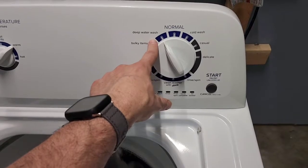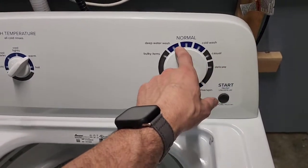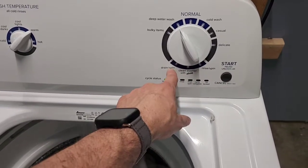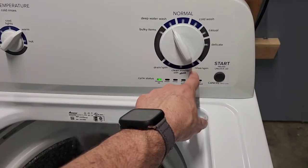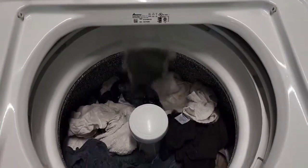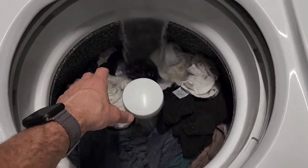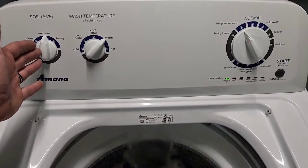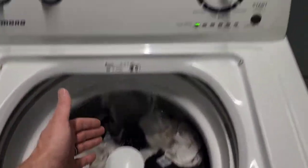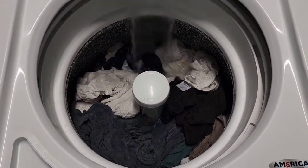It's filling up with water. I have it set on the deep water wash — that's the cycle I prefer. You've also got cycles for delicates, a normal range to save water, a clean washer cycle with a fresh tablet, drain and spin, and rinse and spin. Soil level tells the machine how long to agitate the clothes — it doesn't designate water level like machines used to. It tells the machine how dirty the clothes are and how long it needs to agitate. Water level is determined by the deep water wash setting.